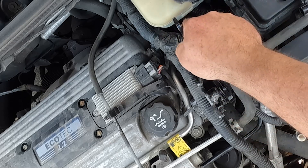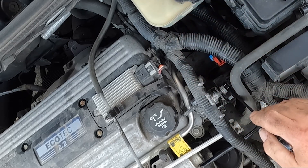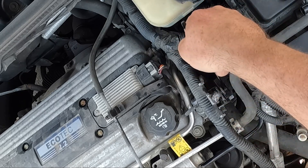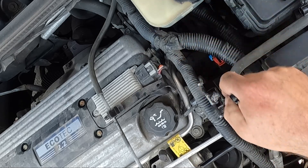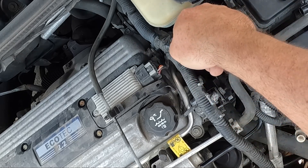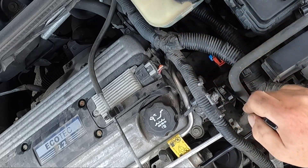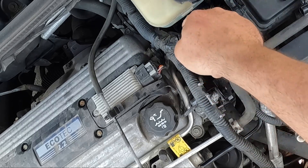While I'm tightening this up, let me tell you about some symptoms. This happens often when I go to put gas in the car — I fill it up, go to start it, and it won't start. I basically have to put the pedal to the floor, crank it over, and then it starts. Rough idling is another symptom, and of course your check engine light might come on.